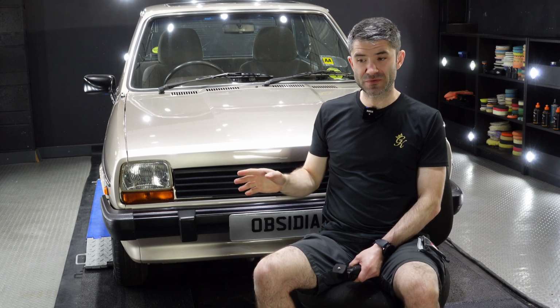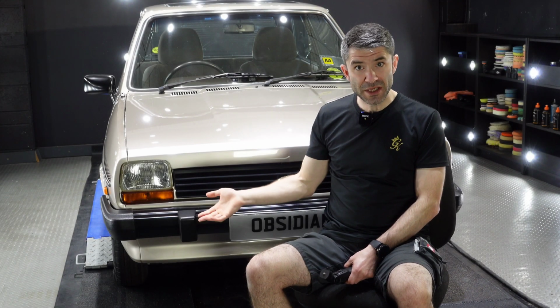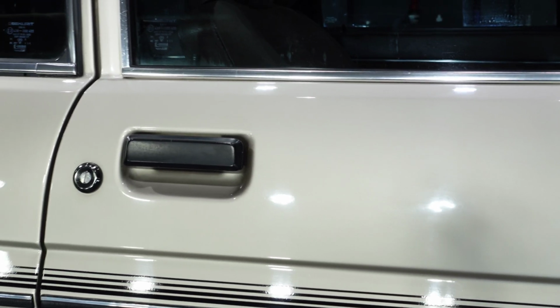So we're dealing with, of course, small colour variances, some blend work, because it's been in a body shop. It's been polished and sanded in parts, so we've got holograms to varying degrees over each panel, sanding marks, flatting marks, DA marks, whatever you want to call them, and some denibbing on some dust on various panels.